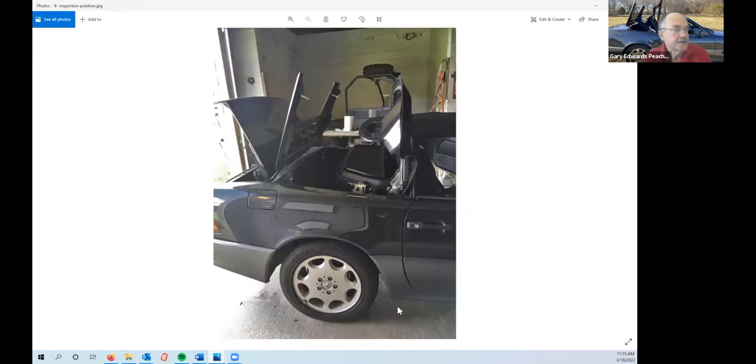This is the position you use to inspect the cylinders. If you're looking to buy one of these cars, put the top in this position and you can inspect either nine or ten cylinders. To get into this position with the top up, just pull back on the top control, watch that the bow comes up, then the tonneau comes up, and then just release the switch — this gives you great access to look at nine or ten cylinders. Later cars only have one tonneau lock; earlier cars have tonneau locks on both sides.